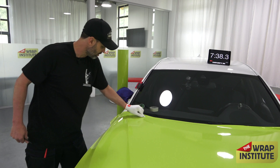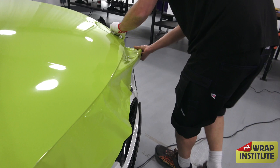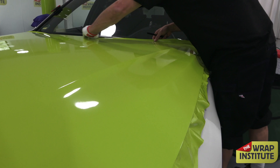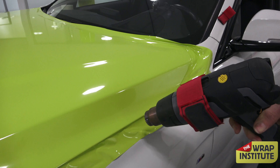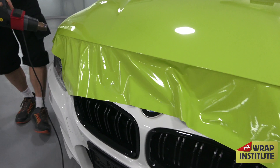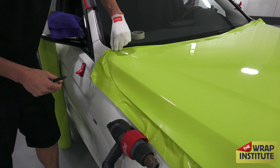For cutting right now, you want to think about really getting the material around the edge. Cutting is where it gets hard — if you're new at wrapping, your chance of making a bad cut right now is really high. A good installer will learn the art of cutting and master it. A good installer also learns to retension, like I talked about earlier with wrinkles. Before I cut, I want to neutralize any tension, so I go around with a heat gun — the heat shrinks the material and relaxes it, just like a hot shower or a hot tub.